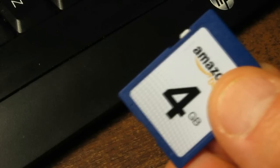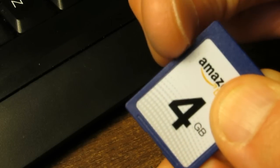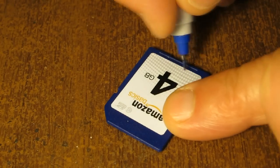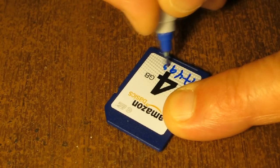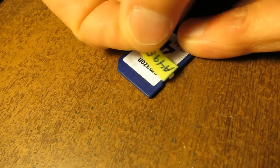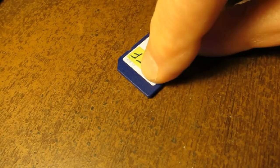There are two final things you should do before you use the card. First, lock the card with the slider — CHDK only runs automatically when a locked card with a bootable version of CHDK is in the camera when it is powered up. Second, label the card so you know it's your CHDK card for that particular camera. The cards are hard to write on, so a sticky label helps.